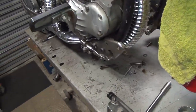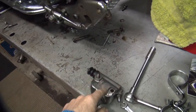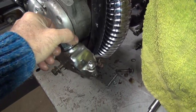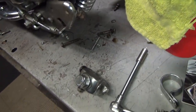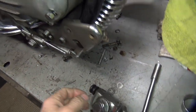We're back on the bike. We're getting ready to work on the brake here. I got the pedal mounted up on here. Now I get the master cylinder on here and I got the brake line over here. Obviously it has to be bent differently to get it to match up to where this is supposed to be. This side's a little bit on the short side, so it's going to have to stretch a little bit. I need to put some spacers between here to get things to line up square.